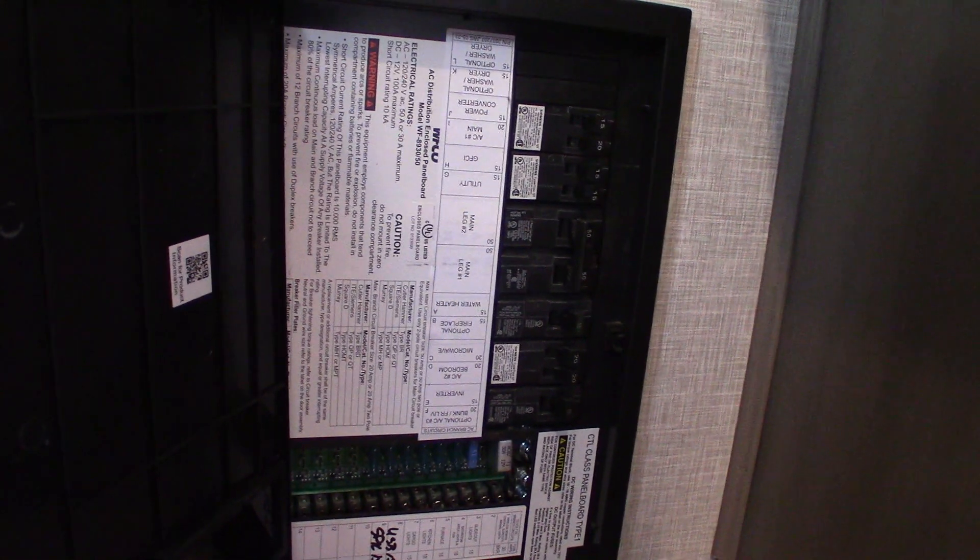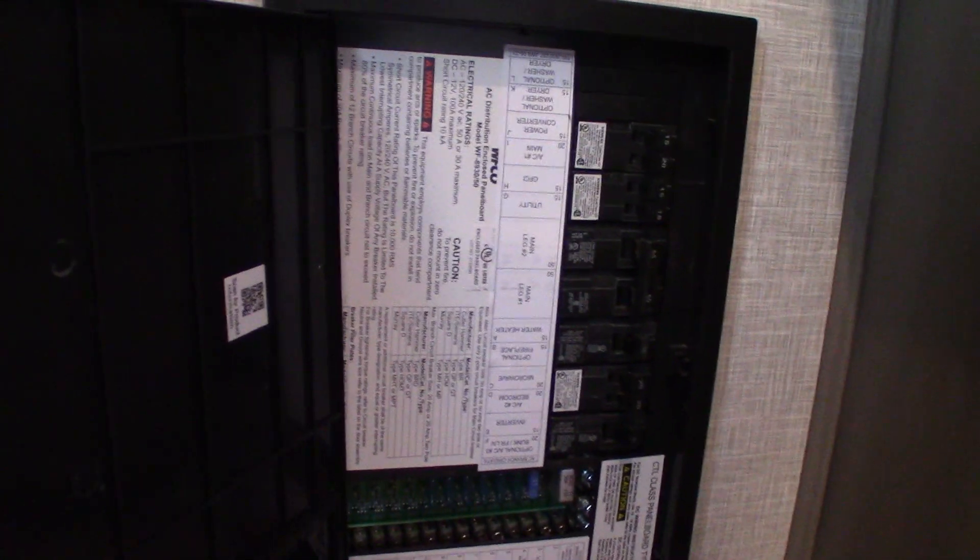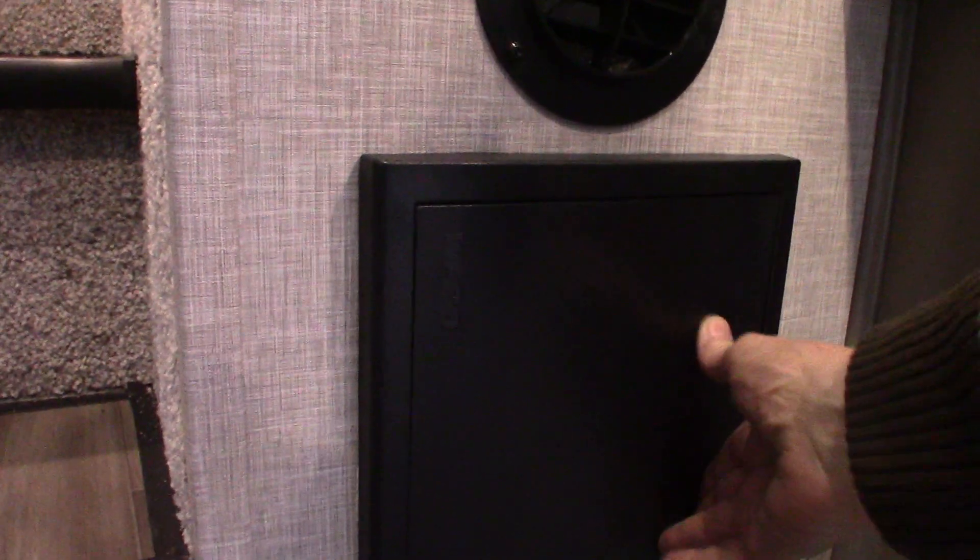This is your power converter right here. It converts AC to DC power. As long as you're plugged into shore power, you've got 110 AC at these circuit breakers — they're all labeled. The power is converted to 12-volt DC down here with labeled 12-volt fuses. It's also a battery tender, so it'll sense how much energy your battery up front on the tongue has and send as many amps as necessary to charge it — 15 amps if it's really low, just a trickle if it's nearly full. When you're towing down the road, your tow vehicle's alternator charges the battery through the charge line.